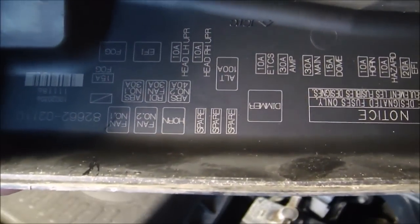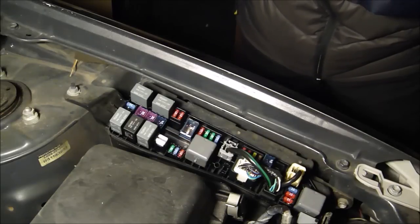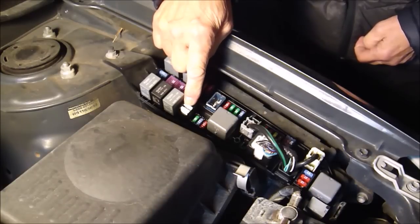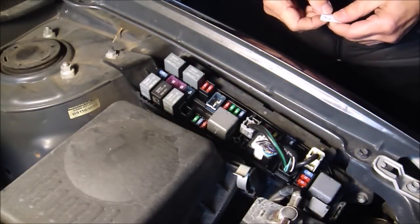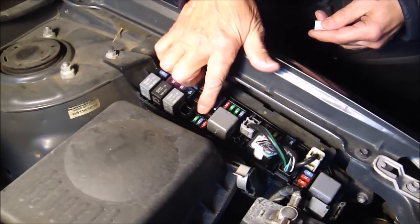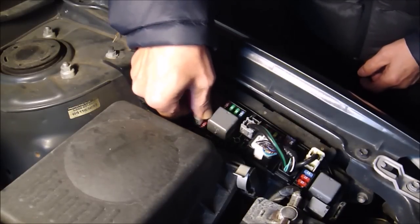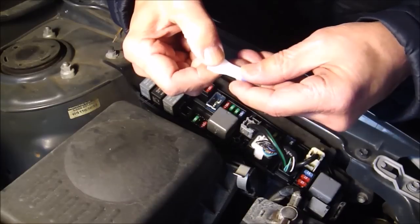Inside the cover, you can see the locations of all the fuses in this box. The cigarette lighter fuse is not in here, but I need something from this box to do my job. One thing is this tiny little white clip. The other thing is a spare fuse — I need it to replace the blown fuse. Here are three spare fuses. The one I need is in the middle: the blue one, marked 15. Insert the clip, hold the fuse and pull it up. Now I have these two things and I can go ahead and do my job.